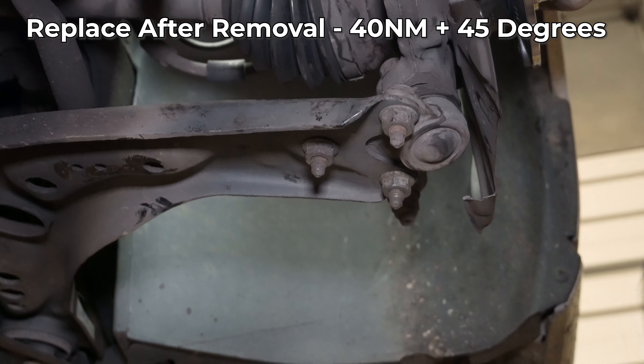Now we can put our brake caliper on with our pads. If you need to, you might have to reposition your brake pads and wiggle them to open them up. Old bolt out, new bolt going in — it has thread locker on it. The torque spec is different depending on which style bolt. How are you supposed to know when your axle is in all the way? Spline it in and make sure it seats against the back. There shouldn't be a big gap between the axle and the hub — that's fully seated.